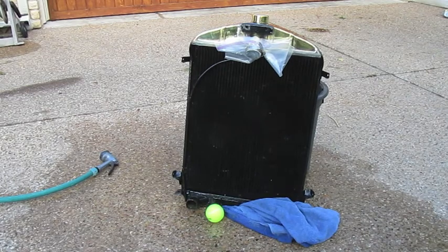We are now picking up where the radiator of a Model A Ford has been returned from the radiator shop. It has been rodded out, boiled, cleaned, and pressure tested. What I'm going to show you now is how the water flow looks — remember in the previous video clip it took about 12 seconds to drain the radiator, which indicates it's very clogged. It should take about 4 seconds according to the Model A documentation.